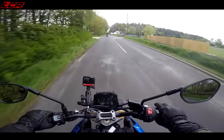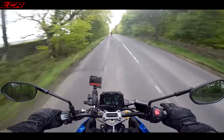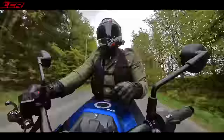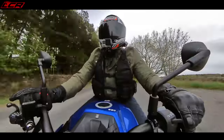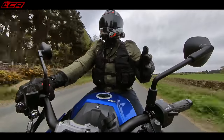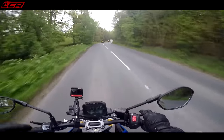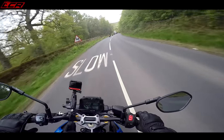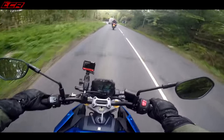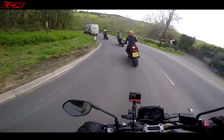It's louder than the S1000R, even with the S1000R with the road legal Akrapovic. This is louder. I don't think it's coming from the exhaust. The sound is coming from the induction roar. What they've done is change the airbox on this. They've made the outer shell of the airbox stiffer so they can remove some of the internal supports. So internally the airbox is just open now rather than having the internal supports, and it really has got a lovely roar, a lovely airbox roar.